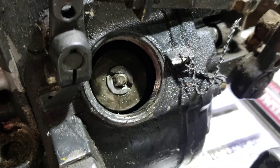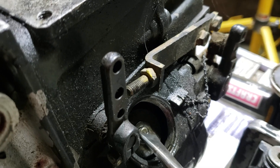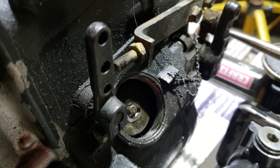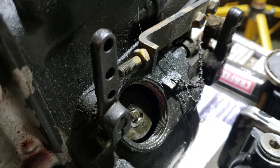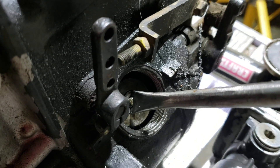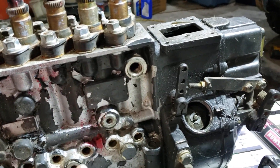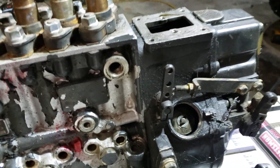That's how we've been setting them up. I'm actually doing these to back this guy off some because the idle wouldn't come down - it was a high idle around 1100 RPM. When I tried to bring the idle down using the idle screw over here - that lever is resting on it - it would just die. That let me know that I had my governor springs probably one click too tight, so I'm going to back them off one click on each one. That's how you'd do it through the side port, but you've got the plate for your throttle linkages and other stuff coming through here, so it's not quite as easy as it looks with the pump sitting on the bench.